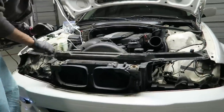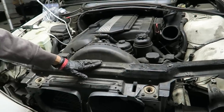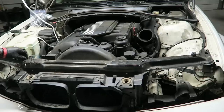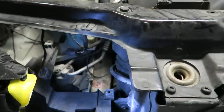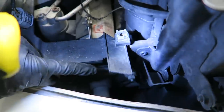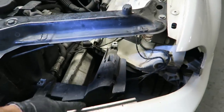Now that both headlights are out, we're going to unhook the radiator. The two bolts holding the radiator just keep it closer to the support so it doesn't hit the fan. Go ahead and remove both of those. Then take off all three of the nuts that hold the whole front assembly to the frame rails — there's one, two, three on this side, and same on the other side: one, two, three. If you've got fog lights, go ahead and disconnect those as well as the horns on both sides.